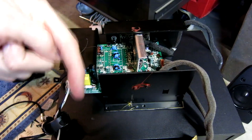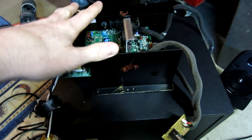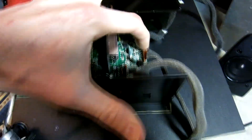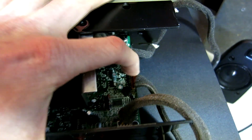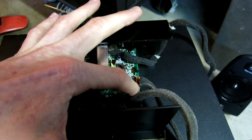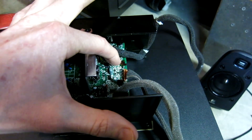I do have a full video — look in the description box below about how to remove your sub, how to remove the screen off of your Z623, and how to remove the amp. Now, some other videos on YouTube show guys with just a loose ribbon wire or bad solder, cracked solder, and they're able to regain sound after that. Unfortunately, even after using a heat gun on some of the solder joints and repositioning these, it does not work. I do have a blinking light when I plug it in, right here on the amp.